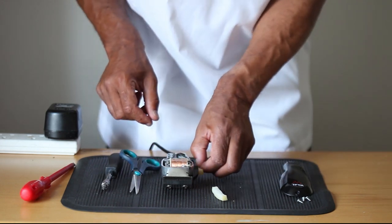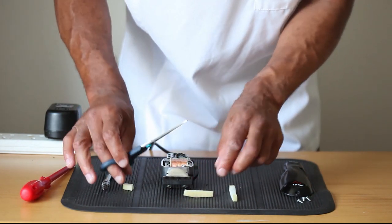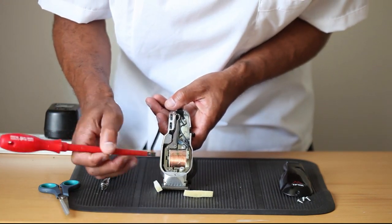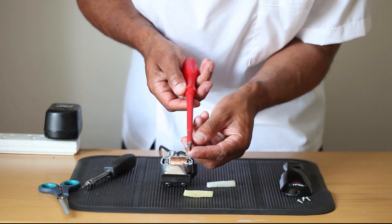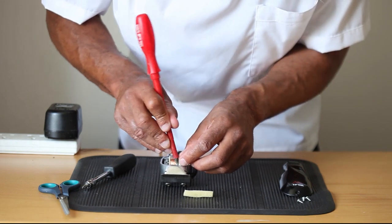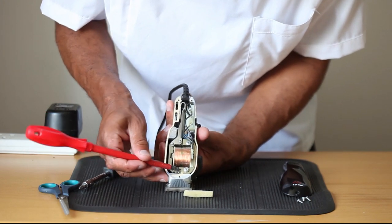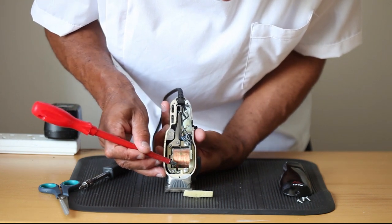What I would do is cut your french fry to about three centimeters — that's the recommended size. Now you'll see I'm going to stuff the sponge in between, starting with the top part first. To do this you need a flathead screwdriver — quite a sharp flathead screwdriver. Please ensure that the power is switched off when you do this, and then you just poke that in there. I'm poking it into the vertical part, and now I'm going to poke into the vertical part that's closer to the coil in exactly the same manner.